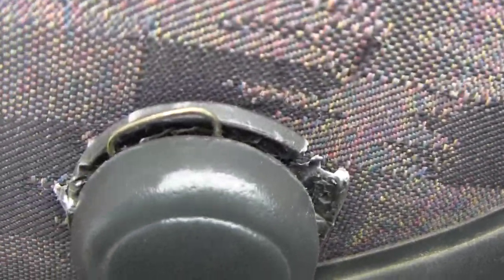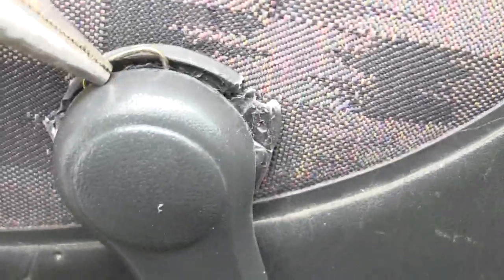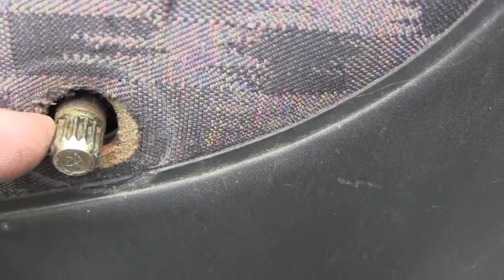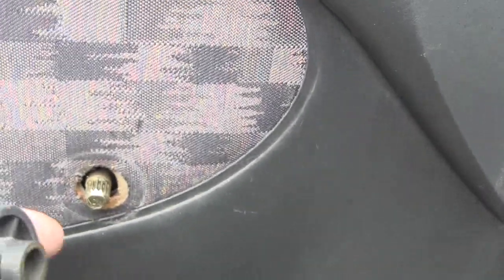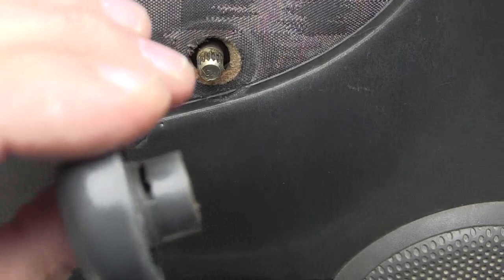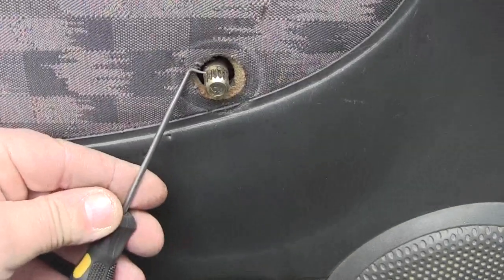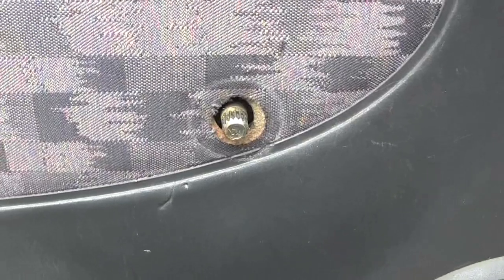There is the little metal clip. I reached in behind it with the hook and grabbed hold of it, then put my needle nose pliers on it. I dropped the clip but I'll find it — this is what it looks like. That clip holds the window crank on; it fits in that slot back there. Really hard to get — you gotta fiddle around behind it and just hope you hook on it. After several tries you're going to get it, but that's the hardest part of all this.